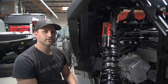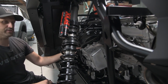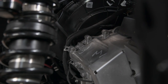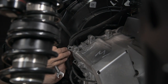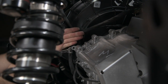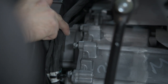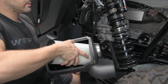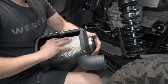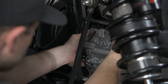Now we're going to start installing the air box. To do that, loosen these two 12mm bolts on the transmission to allow the bracket of the air box to drop down on top. Remove the harness to get it out of the way and back the bolts off about an eighth of an inch. Next, put the filter in the air box, then put the bracket on those two loosened bolts and tighten it up.